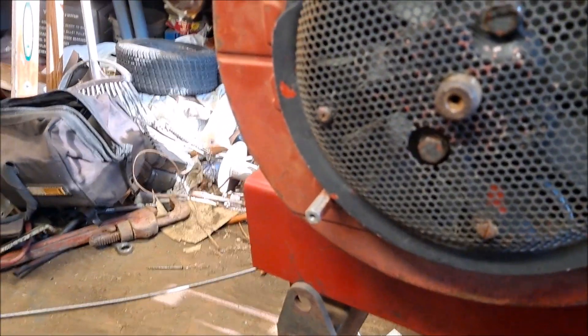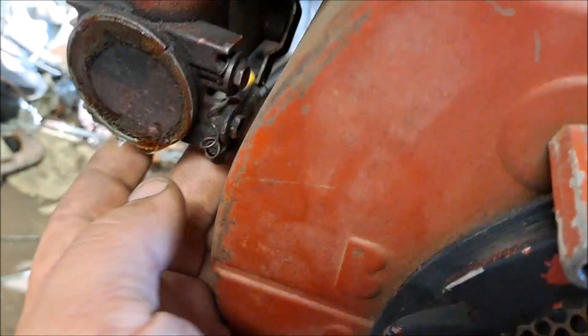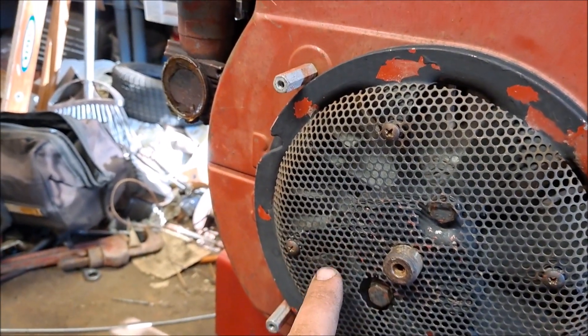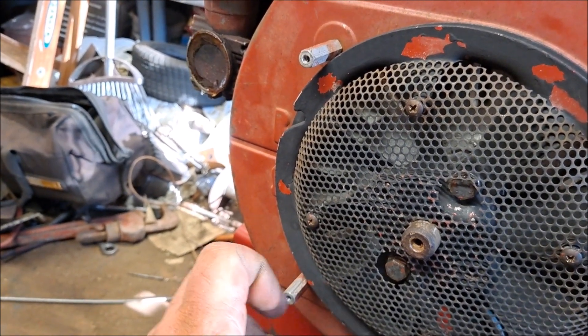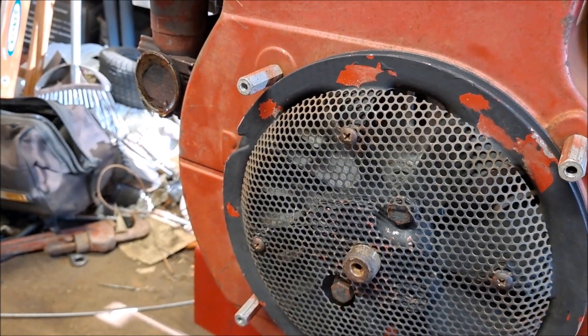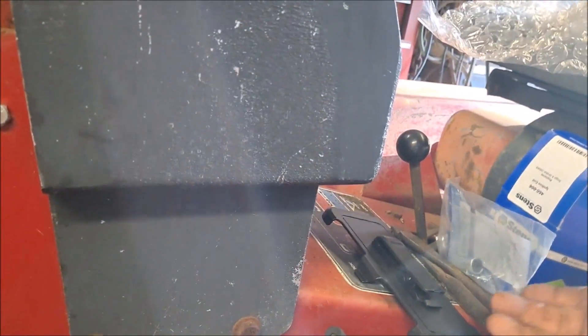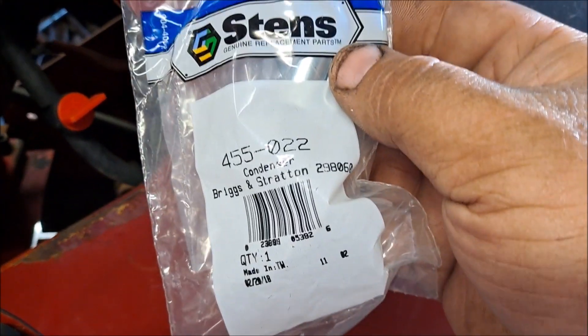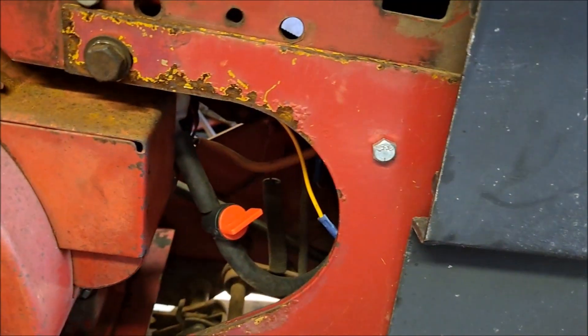The other day I went and picked up some more cast irons. I got this carburetor that's on it now — it's got the correct side on the choke linkage. I'll be taking the spring off because that's not supposed to be there. It still runs. I also got rid of the K-series condenser because it still wasn't tight — it wasn't getting a good ground at times. So it's got a Briggs one back on, a used one for temporary. I do have a brand new one because my parts came today. It's a Stens — probably out of the same factory as the Briggs one. I already opened it up to look at it — I've got a brand new coil magneto in there.